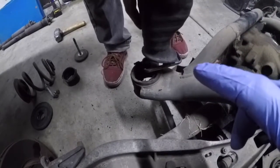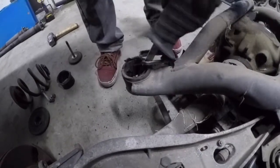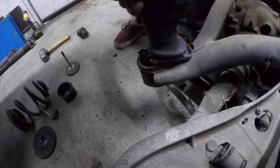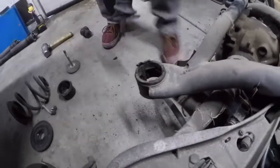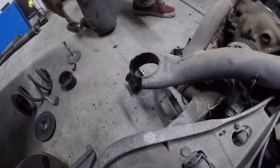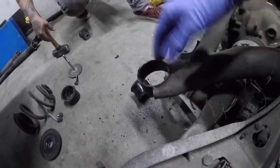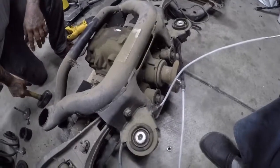Now that we've got the center out, we're going to grab the sawzall and start cutting it — but we're going to cut it towards the inside, because if we damage it, it's easier to fix the inside than if we cut out the outside. Once the blade grabs, you know it's cut all the way through and actually squeezed the bushing against the end of the blade. We're going to cut in two spots about an inch apart. Then we go back to the mallet — the mini Thor hammer — and it should knock the whole entire thing back out through the middle. Make sure you don't cut through the housing. Once the blade grabs, just stop there.